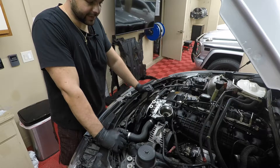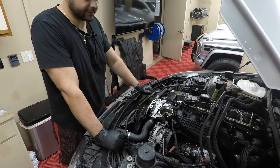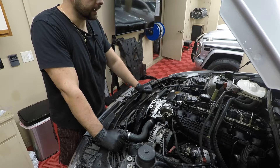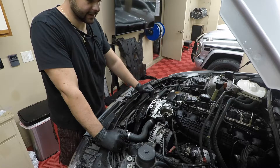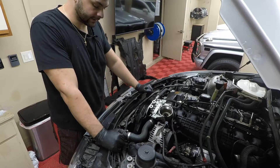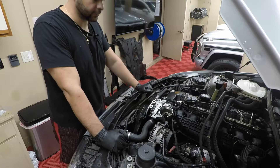I left this loose so that we can wiggle the intercooler in, because I still need to get underneath and plug the radiator and intercooler, and put the drain plug back in for the oil line. Once we do that we can fill it with oil, fill it with coolant, and get started. Let's hop back underneath the car and put the coolant drain back in and get the intercooler back in.